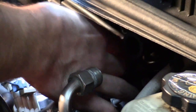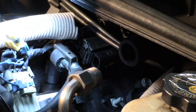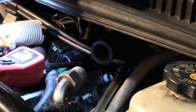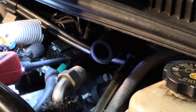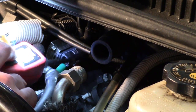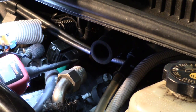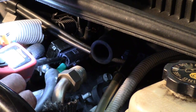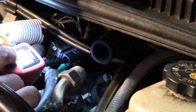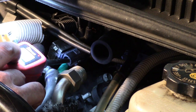Next I want to put 12 volts onto the solenoid contacts. I may have to remove the solenoid, but we'll see. I've got a jumper wire to negative and this will be my positive on the other contact. One of the nice things about this power probe tool is it doesn't give me 12 volts until I push the button, so I'm not worried about a hot wire hitting every possible ground. I've got the microphone right next to it so we should hear it click. And it does click.